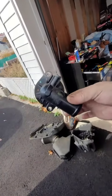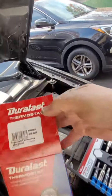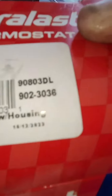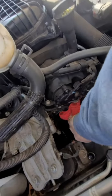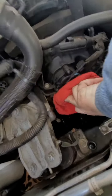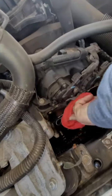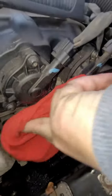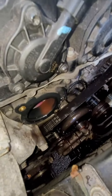I already purchased a brand new one with the housing, so we're going to put the old one in the box. The part number is 902-3036. There's no RTV on here — there better not be anyway. So I'm going to clean off the housing and the mating surface a little bit to make sure we get a nice seal so there's no leaking.